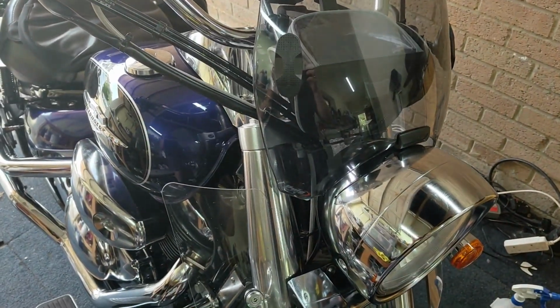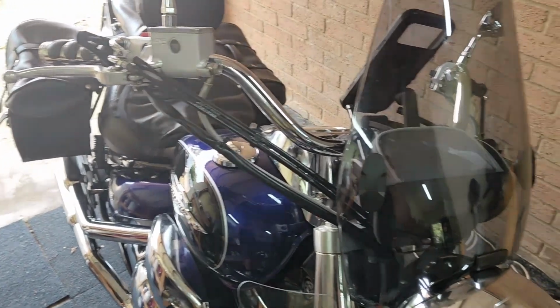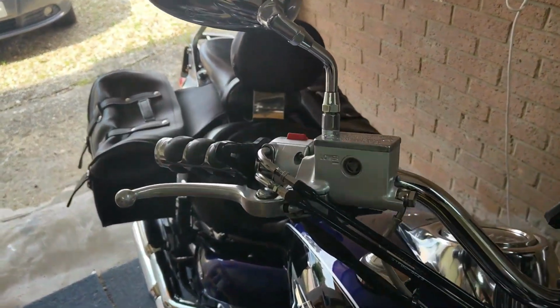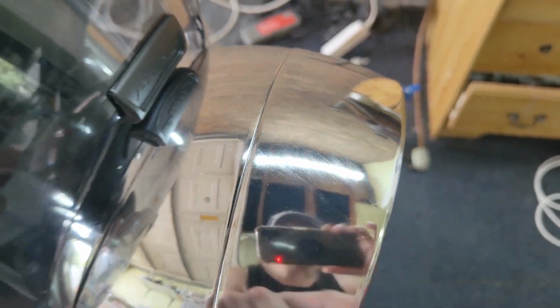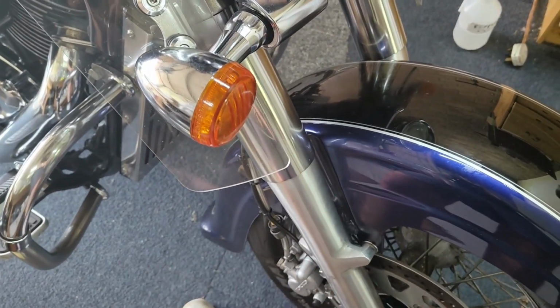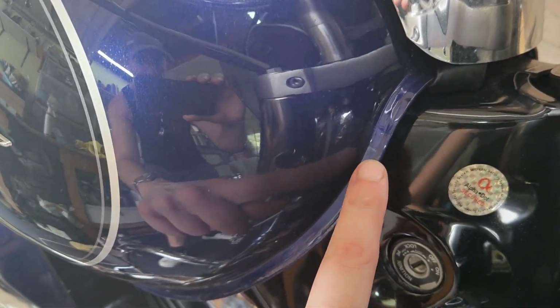The whole bike done. It really doesn't take long, maybe like 15 minutes. Yeah, only about 15 minutes, and everything's left with a bit of an oily sheen to it now, which is basically the protection. You can see it there, look. Particular areas to pay attention to are any exposed aluminium, like the forks. Also, seams around the tank.